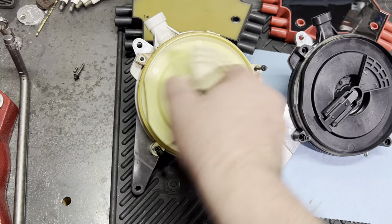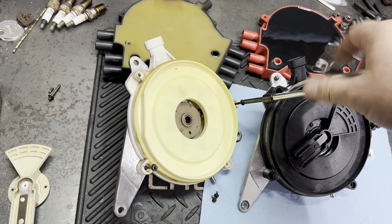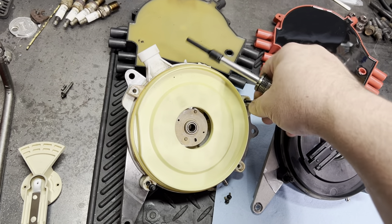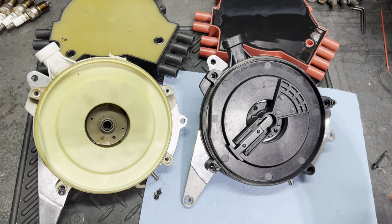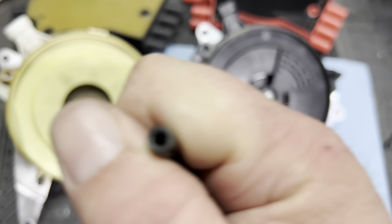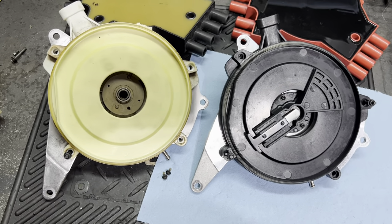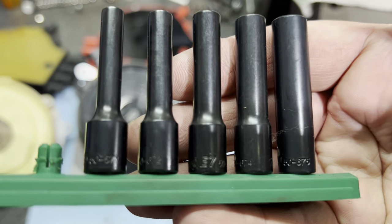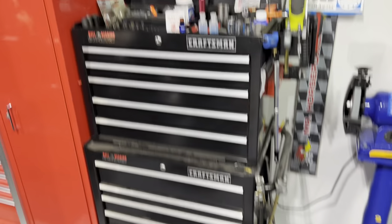I'll take this rotor off — you need a special tool for this. You can get it at AutoZone but you have to buy the whole rack. It's not really a Torx, it's almost like a triple square. The size is E7. I've got a lot of tools, but this was a new one on me, even being a Chevy guy my whole life, because I've never done an OptiSpark.